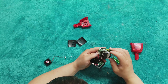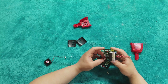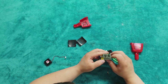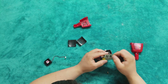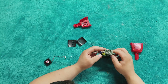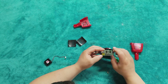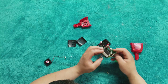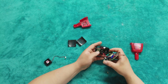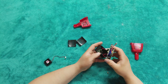You've got a lot of diodes and SMD resistors on here. The brains of the unit would be right here — I believe this is voltage detection, probably a low and high voltage detection board. If it were just a low detector, the inverter would have shut down a lot sooner given everything I put it through. I don't see any other chip with the exception of this USB circuit board, which is pretty generic.